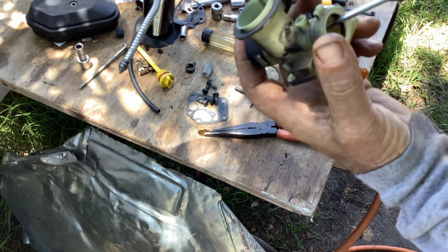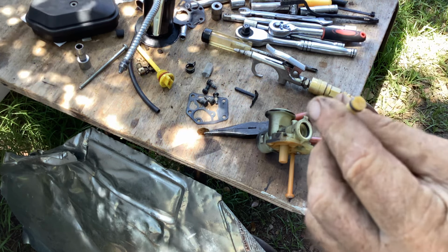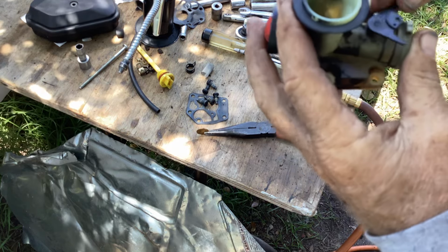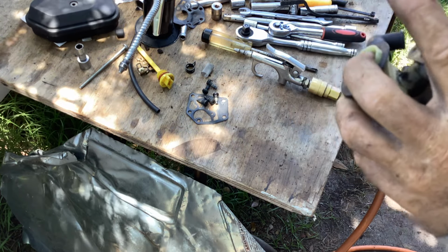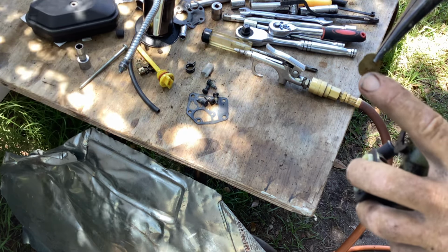There we go. So I recommend you take these off because debris can find its way down here and plug that up. Not so much here on the pickup, but I've seen crapola up in here. So since we don't have to do anything to that, we just push that down all the way until it clicks, like so. Put my stem down, and the brass wafer goes in. The two notches face out. Single notch is what you're pushing through the stem. Check movement, free and clear. Okay, I'm happy.